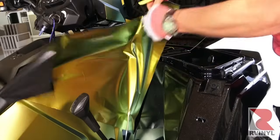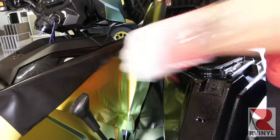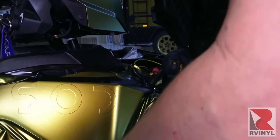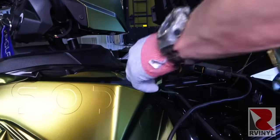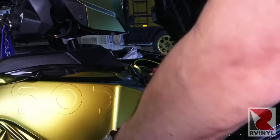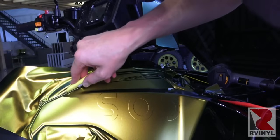from one side to the other side, and this is when the material is going to be cut away. And the next piece will go over this as an overlap. So here the material is being picked up and fed in, and the knifeless tape cut away. The reason why this is being wrapped in multiple pieces is because it's such a complex shape that wrapping in one piece will take a long time and may result in the material overstretching.